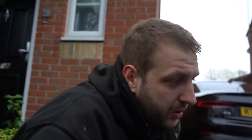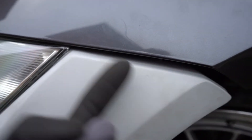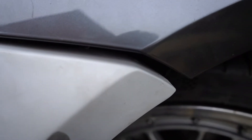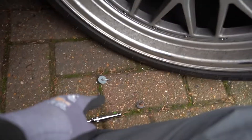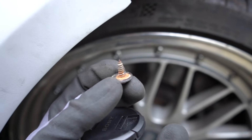We've run into a little bit of a problem. Because this bumper is a little bit thicker than the other one, the screws to hold the side arch — the side part of the bumper up here, there's two bolts, one there and one there — where it's slightly thicker, the screws are not grabbing. They're just too short, not grabbing enough. So we need to find something a little bit longer to make it grab.